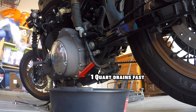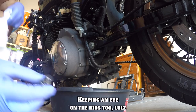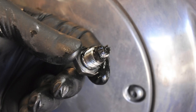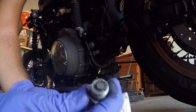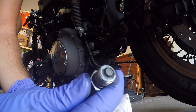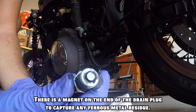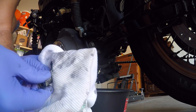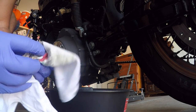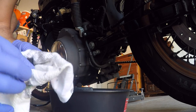Alright, so now we're draining the oil. Make sure you don't drop your plug in there. This is the plug that you unscrew — it has a magnetic end on it right there. That little end piece is magnetic and it catches any pieces of loose metal inside the primary box. Go ahead and clean that off and set it to the side. Don't lose it.